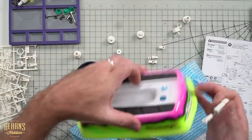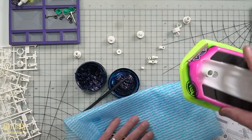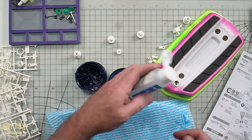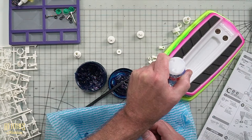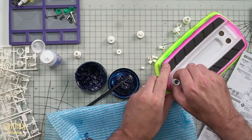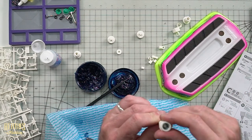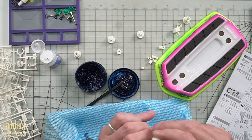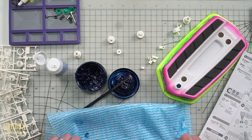That is beautiful. I've got my shock stand or workstation here. I'll sit the first damper unit in there and start filling it with oil as per the book. Like I said, I'm not going to use the manual's prescribed oil — I've got this factory team oil here and I'll fill it up as per the instructions. We'll fill that up and then pump it a few times to make sure there's no air trapped under the piston. Then I'll re-top it up, get all the air bubbles out, and put it back in my shock stand ready to go.